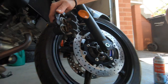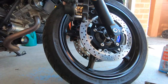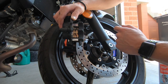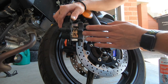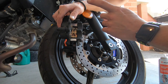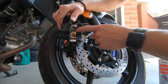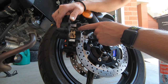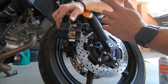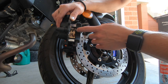There you guys have it — nice and shiny again. I got all the gunk out, especially on these surfaces and inside here, as well as the clip. I don't recommend replacing your clip. The reason being, this clip is already seated well and doing its job. If you clean it and leave it, it will do its job its whole life as long as you don't bend or break it. If you replace it, it may not seat exactly the same way, and you can get brake squeaking or pads not seating correctly — I've seen that on bikes and cars.